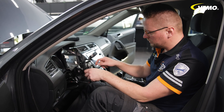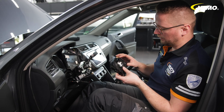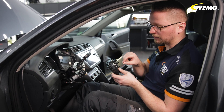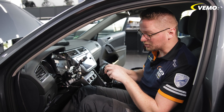There was a screw at the bottom here and two clips at the top. Once you have unhooked the cables at the back, you can pull everything out towards the front. It is important that you do not twist the component. A safety catch is fitted to the new coil spring — it is in the straight position. Please do not twist it.